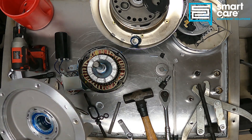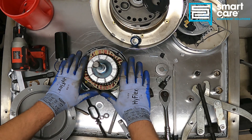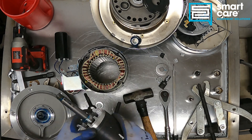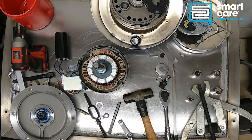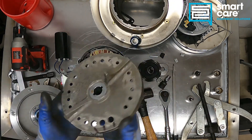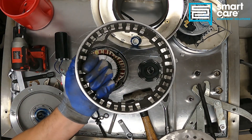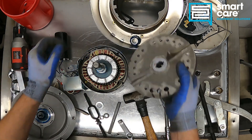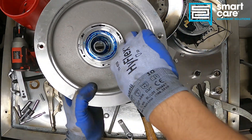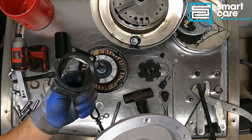When we talk about principles of operation: we've got an electric motor, very straightforward just like every other motor — the only difference is it has a long shaft which goes through several additional bearings and several seals. Once we get past the bearings and seals we get to our rotating shredder, which is just a cast iron disc that rotates inside our stationary shredder. Then we put water and food waste in, the entire system gets shredded up, falls down into this area, and is washed out the outlet — which was this piece we took off back at the very beginning — and this is threaded to attach to PVC or copper pipe.